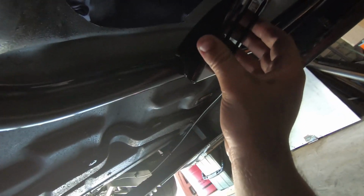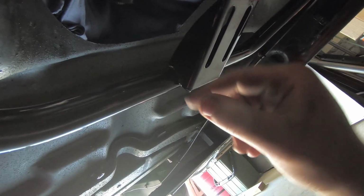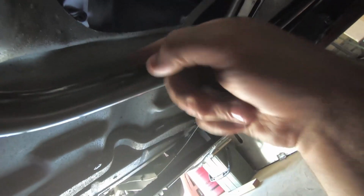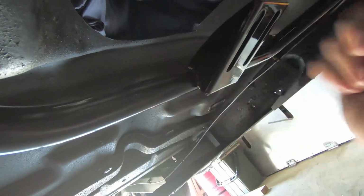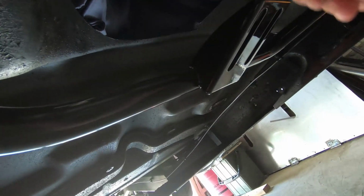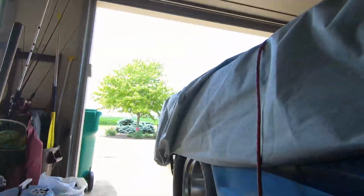But we got this bolted in. I got some dash bar from an old roll cage that's not used, and that's what I'll use. So I'll get my measurements off here, then grind off a clean spot, probably cut off this guy, and then make that little loop that'll go from the top, and then have a piece of flat steel welded to that, with the holes drilled in it.